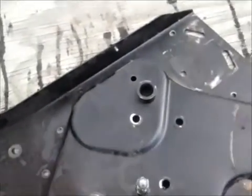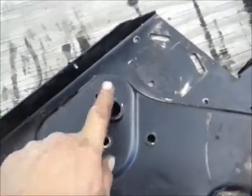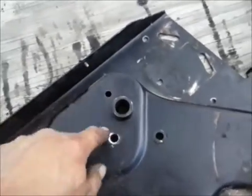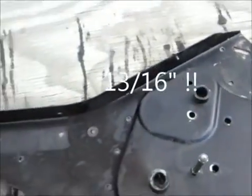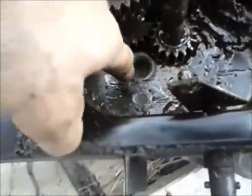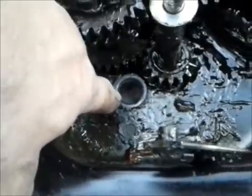I've done a little research, and if you're having to do this same thing on your tiller - the shaft is $65 to replace, and it wore out the shaft a bit. The ID on the bearing is 5/8-inch and the OD on the hole is 15/16-inch. I'm not putting needle bearings back in - I'm going to put in oil-lite bronze bearings or bushings. This other one is the one that comes in off the motor side, the input side. I'll walk you into the garage and show you the low-cost repair of the shaft.